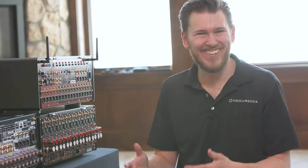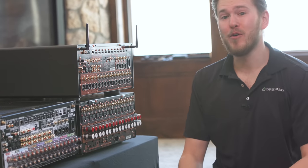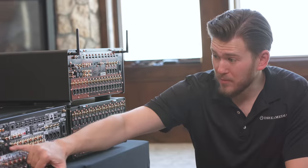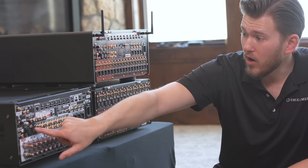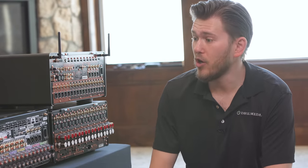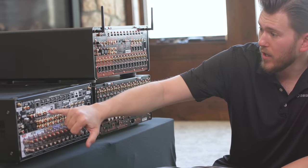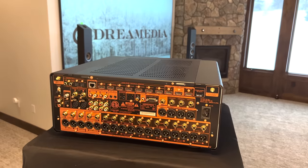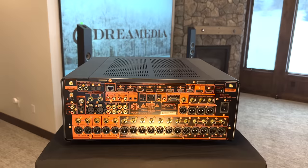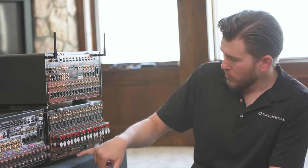We have the AM/FM antennas — still don't know why they have these in there, but they're there. We have audio in for your phono, left and right, and assignable audio in for high-end CD listening. I'm actually really impressed — not only for CDs, but anything high-end audio. You're going to use XLR inputs into your AVR or separates, and I'm really surprised to see here on the Denon A1H that they have XLR inputs — that's impressive. I expected it on the AV10 at this price point, but it's nice to know they have it on the AVR as well. We've got pre-outs for Zone 2 and Zone 3, lined right up with the AV10, and then trigger out as well as remote control in and out.